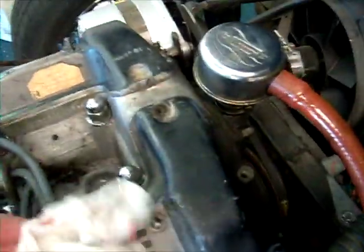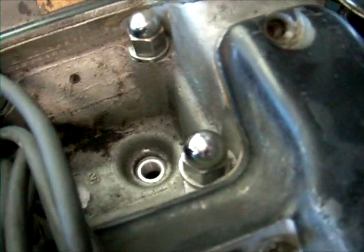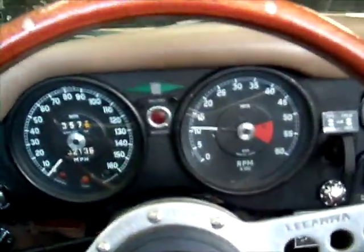One more thing I found out: I used too much Loctite and it ended up dripping inside the cylinder - I had to go sop it out with paper towels. And while I was doing that I found one more big blob of chips, pushed out by the insert. So check again in your cylinder for blobs of chips after you put the insert in. Now we'll put the plugs in and start the car. And it's holding - there it is. A successfully completed repair.